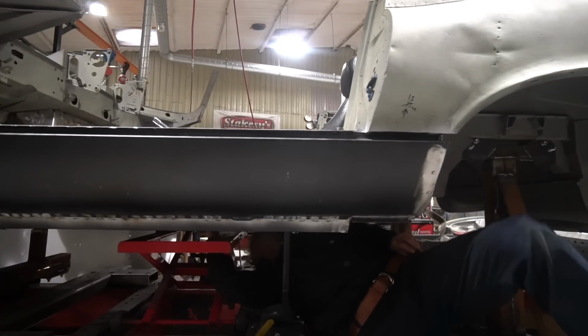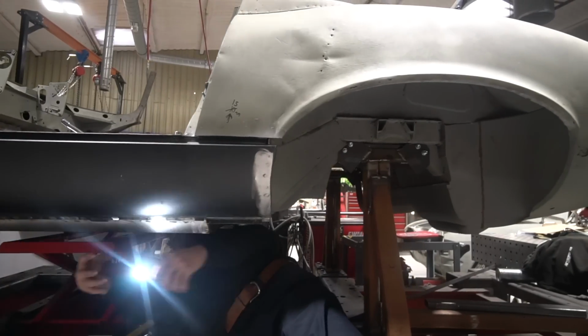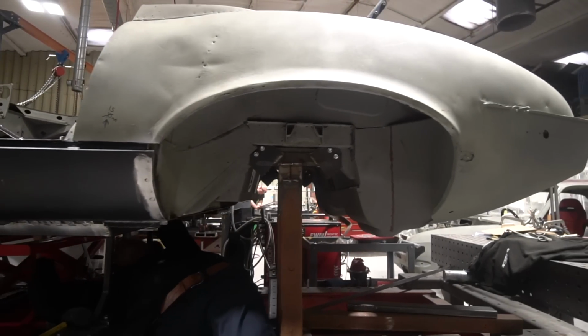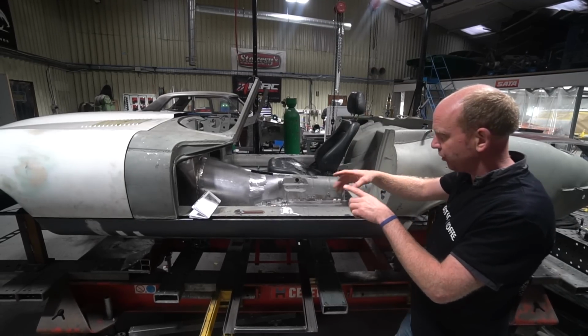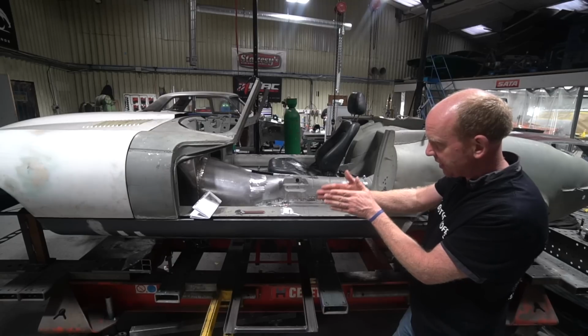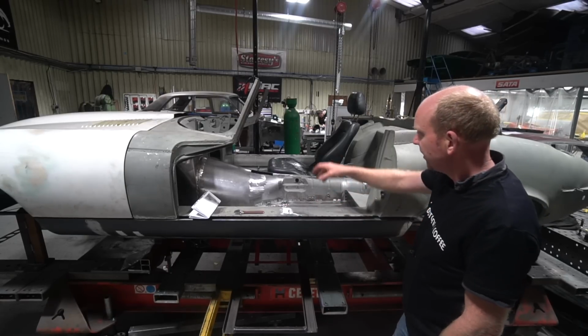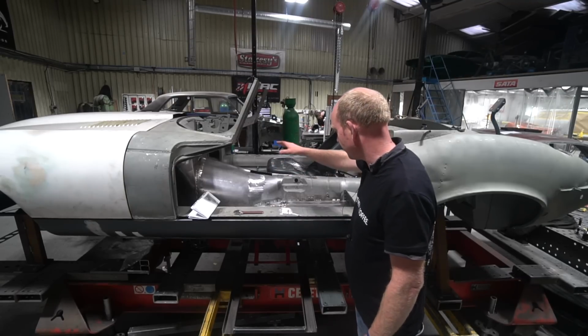There's an initial hole cut out, and then there'll be a sort of box dropped into that hole and welded in. With the side mounts, we take off the original Lokar brackets, which are like a 90-degree bracket on each corner, and then we'll mount it directly from a pair of sandwich plates off the sides of the Lokar shifter, and they'll be mounted into that recess there, which we've worked out the position on.